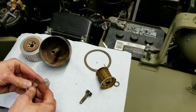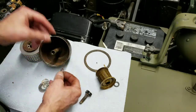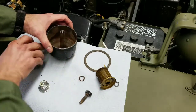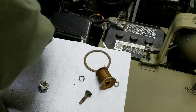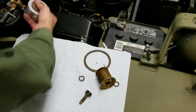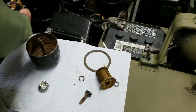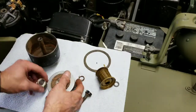The old spring is completely broken and corroded — there were pieces of it in the bottom when I cleaned it out. You need the spring, which goes on first over the post before the element, to hold the element up so it prevents raw fuel coming into the filter from entering the filtered fuel line. That's accomplished by pressing this cork gasket up into the top of the filter housing.